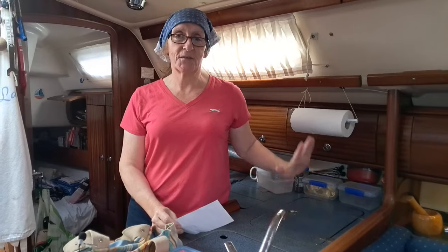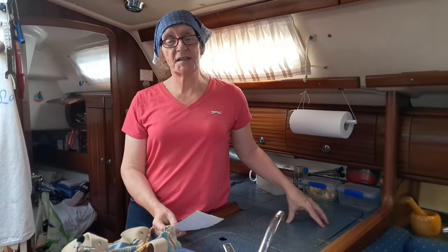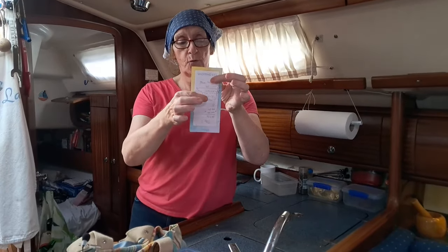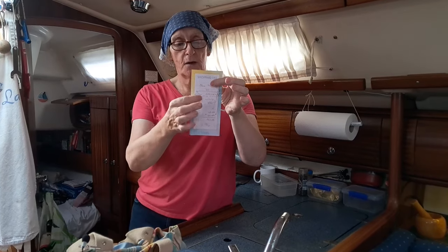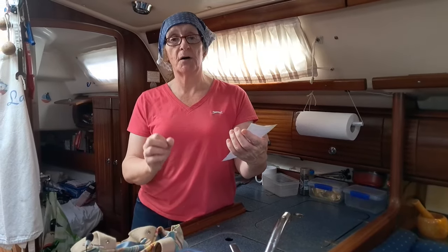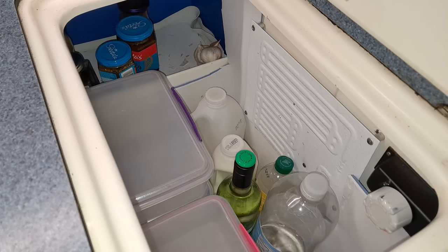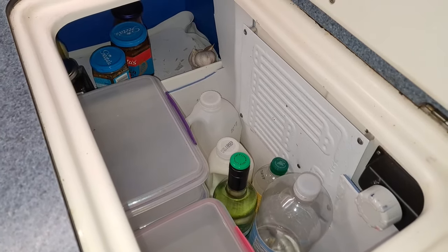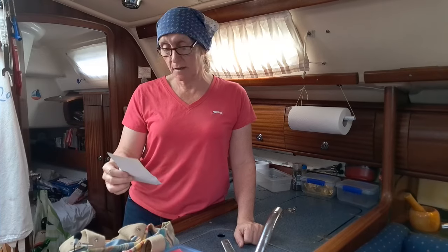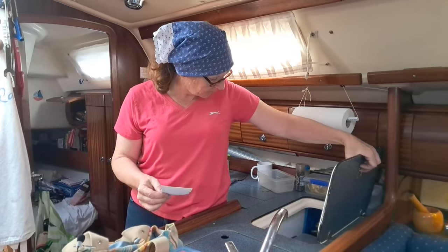Obviously the Isotherm replacement is for an 80-litre or 150-litre fridge, and ours is 96. However, it's like two boxes stacked on top of one another. The volume of the bottom box is 47 litres, the top box is 49 litres. We don't really store very much above the parcel shelf — nearly everything is in the 47-litre section below. So I'm inclined to get the Isotherm 80, because the top part of the fridge contains nothing except fresh air.